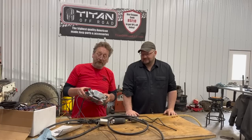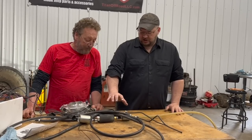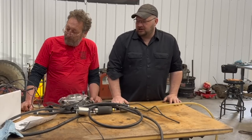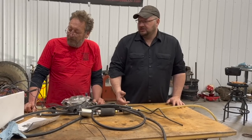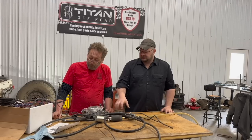It's not a firearm — it's a fuel delivery system. We're going to have to get off your carb, install the fuel injection unit, and then do some wiring because it requires a tach signal. We got to put an O2 sensor on there and a coolant temp sensor so the system can read that.